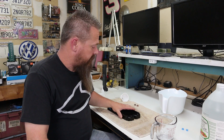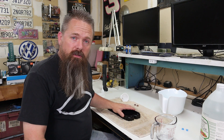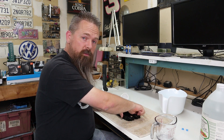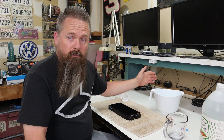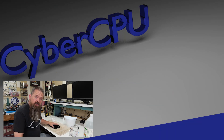We're back — I just finished three rounds of rinsing this radiator out and we shouldn't have any remaining vinegar in it now. What I would do at this point is, unless you're going to install it immediately, put some caps back on to avoid any debris getting back into the radiator. Since I don't have all the parts yet, we're going to put this away until later. All radiators on the market are going to have some debris left over from the manufacturing process. The manufacturer does the best they can but it's still a good idea to clean them yourself — just look at what we got out of it. Please like this video if it was helpful, and if this kind of content interests you please subscribe to my channel and hit the bell icon so you can be notified of future videos. Thanks again.